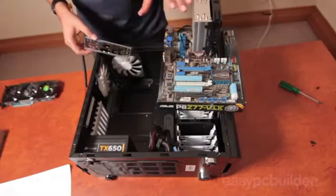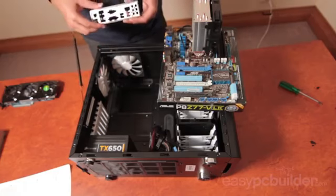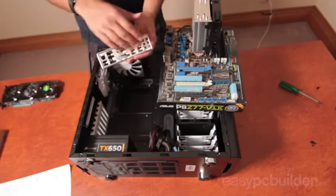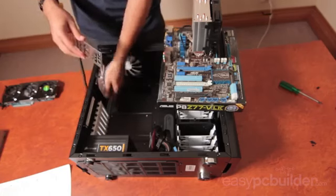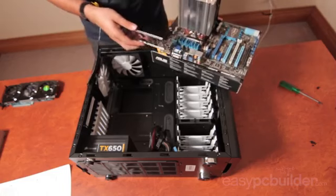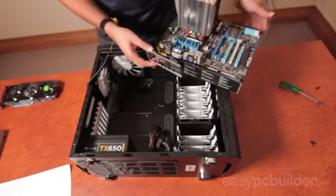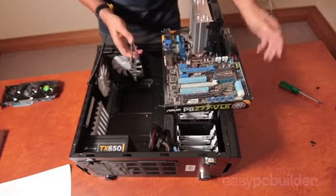So now before we put the motherboard down into the case, there's one thing which I've forgotten many times earlier, which is the motherboard backing plate here, which installs down here for the rear motherboard access points. Now, if we see on the board, the plate can install in two orientations. We need to check that it all corresponds by comparing it to the board itself.